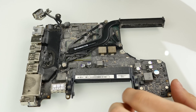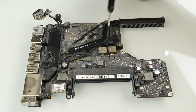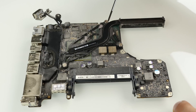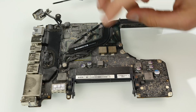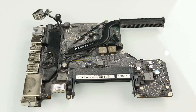Here's the logic board — you can see four Phillips screws securing the heatsink. The logic board is super small, just about the size of my hand, and the heatsink is almost a joke — it's just a heat pipe and it's very small. That means no overclocking on notebooks, really. You can overclock the Nvidia GPU but it's definitely not recommended if you want a good lifespan. As you can see, it's super dirty inside, which is bad for heat dissipation, so I'll clean everything and also clean the backside with a toothbrush using alcohol.